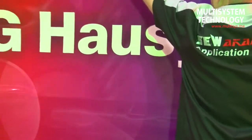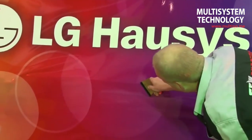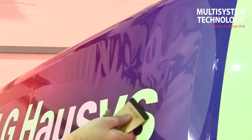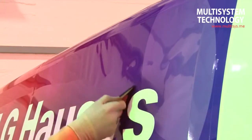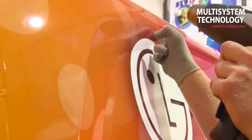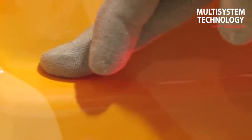When gluing particular areas, the following steps must be adhered to. First of all, glue the film entirely over the seam. Then warm and blow the film where the seam occurs at the highest point. The optimum range of temperature for laying the film in the seam is between 50 and 60 degrees Celsius. You can tell this is the case by a puckering and then smoothing of the film. Do not smooth down the film too tight at the seam; the film maintains enough potential to stretch without it coming to stress whitening or tearing.